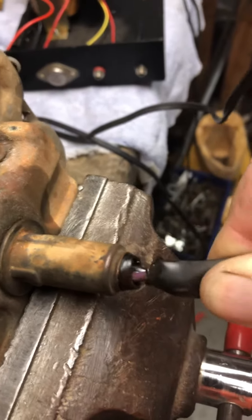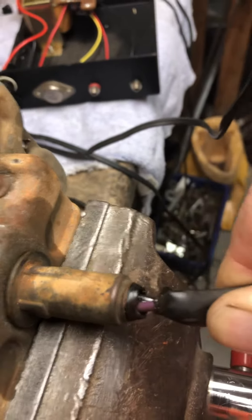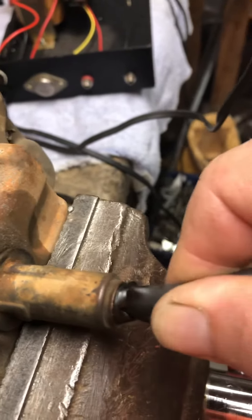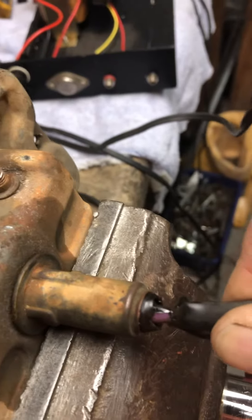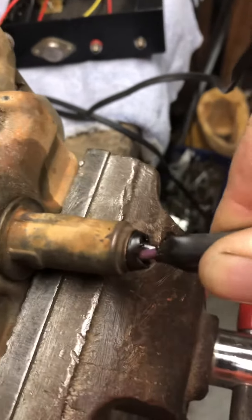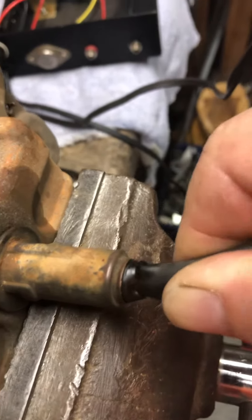You see how those wires are showing and not showing — that's the spring action inside the socket. The bulb pushes down on it when you insert and twist the bulb in. If it doesn't spring back and forth, it's not making good contact, and that's why your lights won't work.